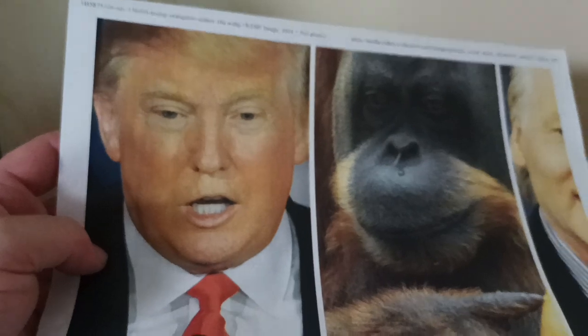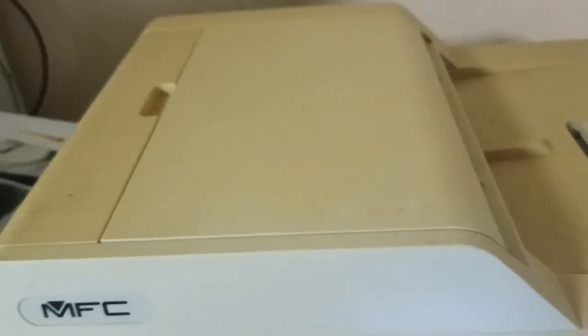As you can see, that is a huge improvement. We've gone from this result starting off with the bad cartridges, to this result just using the paper method, and then straight after cleaning the rollers the cartridges are unbalanced and coming out poorly — but after running the printer for a while, they've come back looking great. That's how you improve the print quality on your Brother printer when your cartridges have become affected by heat and humidity.